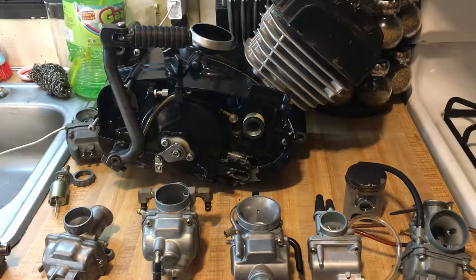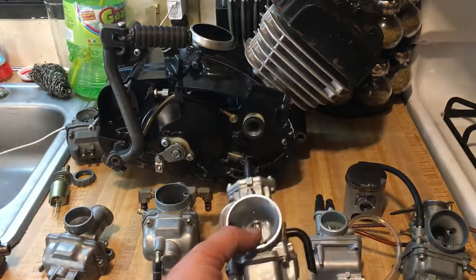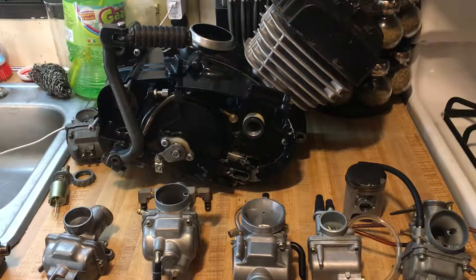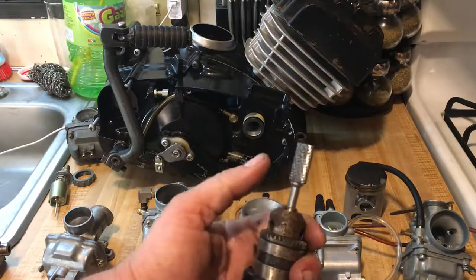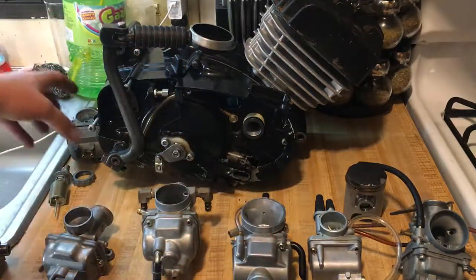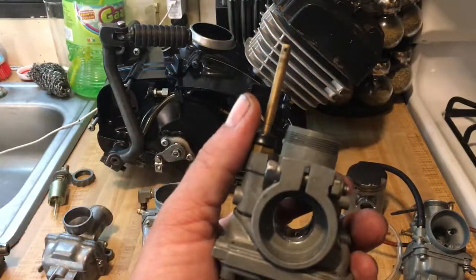This is 102cc with a small intake, small exhaust — everything is tiny on this bike. I'm going for horsepower, torque, and RPM. I don't want the bike to bog at half throttle. So I'm going to use my die grinder with a metal chamfer bit to remove metal from the carburetor. You can get more power just out of your factory carburetor by doing this trick at home.